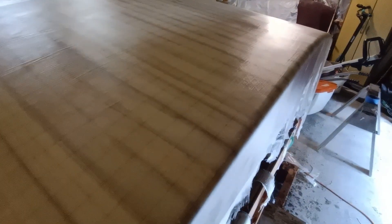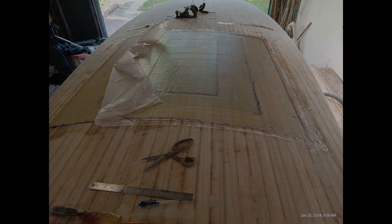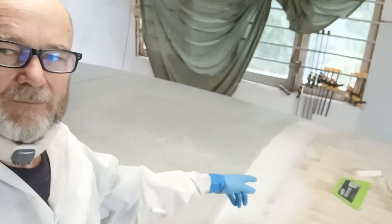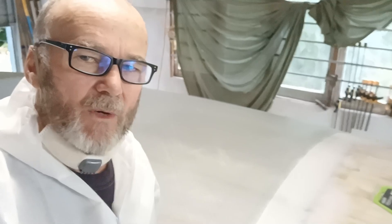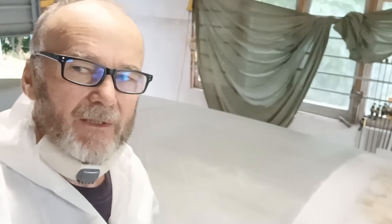As you can see there won't be a lot of fairing to do. Day two of glassing the bottom — as you can see in the middle here I've already got nine layers of glass and three steps, so by the time I've got another two on the bottom that'll equate to 11 layers around where the daggerboard goes down through the boat.